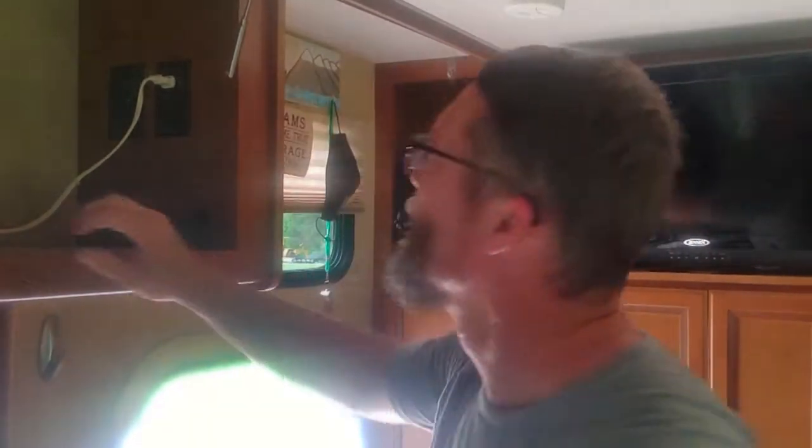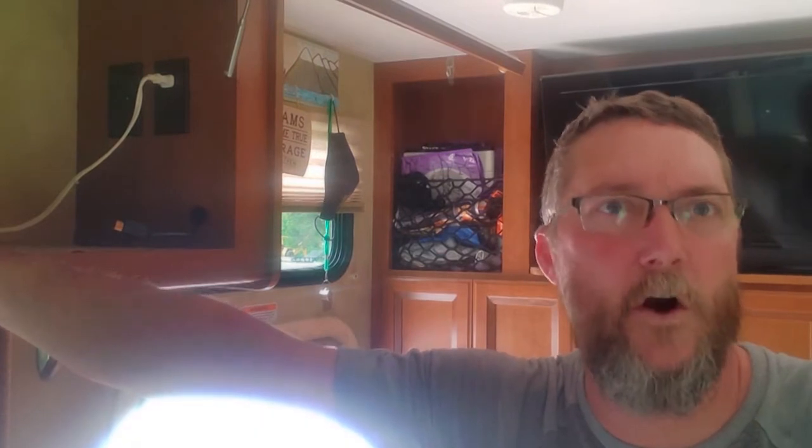Now, the cable on this RV, there's two different types. One, you have a cable TV line that is outside in the back, so that if you go to an RV campsite that has cable television, you can plug that outside television plug into the side of the RV, and you'll have cable TV. I think you have to turn the power booster off when you do that. Cable TV is already boosted. Antennas require a booster. Normally when those are wired up, the outside antenna connection is not boosted, but the one coming off your roof is.